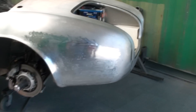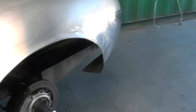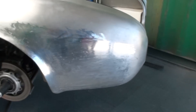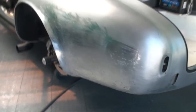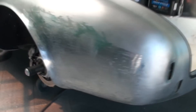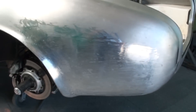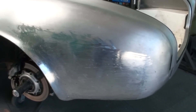Here we've finished the pounding out of the fender and the filing. You can see that the fender is all back into shape, looking really beautiful. See the reflections as I walk by? The fender is all straight now — that's the original metal pulled right back into shape. If we zoom in closely, you can see where I filed out all of the little dents; the panel's all straight. Now what we're going to do is sand out the file marks, brush it, and we'll be finished — ready to deliver the car back to the customer.